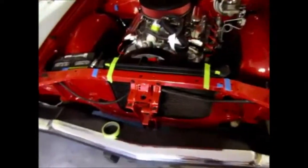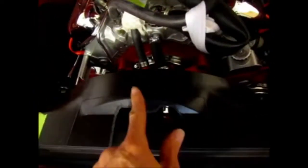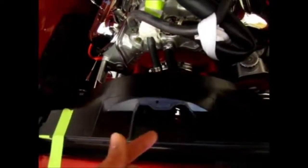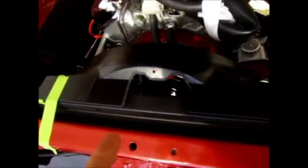The idea is I need a mounting point for the bottom. With the Camaros, there's this bracket. I was thinking about using this, so I flattened it out, but I didn't do a good job and it's not going to work anyway. According to my research, this portion of the shroud is actually on the bottom, and on the Nova I had to flip it upside down. So the original Camaro mounting location would go on some place like this area here.